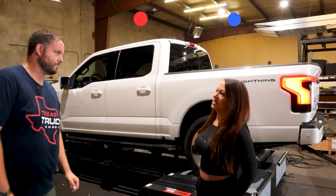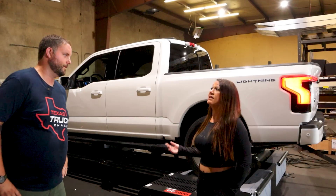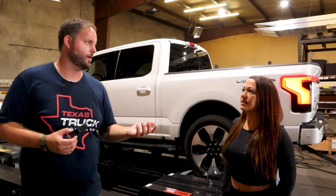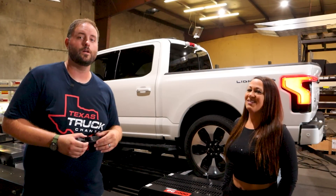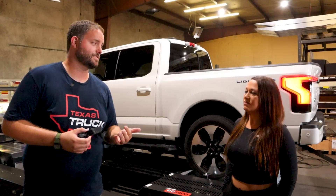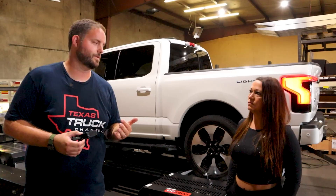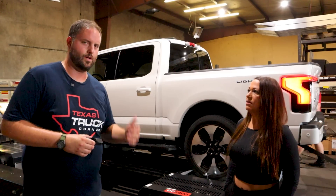Well, we've evolved just like the automotive industry has evolved, and we've come up with our own custom gearboxes, gears, and drive shaft. These two units are actually rollers. Early on I was like, 'Hey, we're going to do hub dynos — how are we going to do this?' Paul helped explain how that's not going to happen. We're actually using rollers, and they're mechanically linked — there's actually a drive shaft between the two, which is pretty proprietary. There's also individual speed sensors for the front and rear rollers so we can tell what the power distribution is between the front and rear motor.